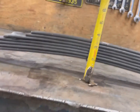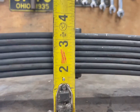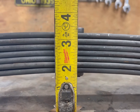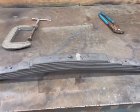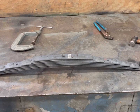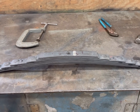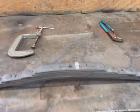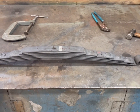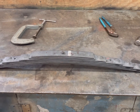It's been through the press multiple times now. Let's see where we're at - about three and a quarter. So we've got another three-eighths of an inch out of it. I'm going to mock up the front end and put some weight on it to see how close I'm getting. I don't have all the weight on the car, but I'd rather have it too low and add a spacer than have it too high and start cutting crossmembers trying to get it to fit.